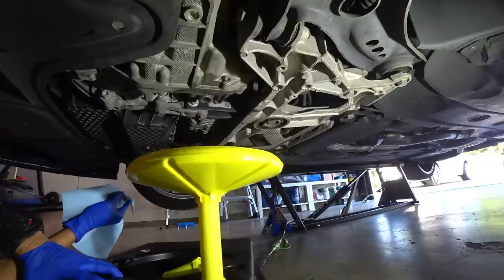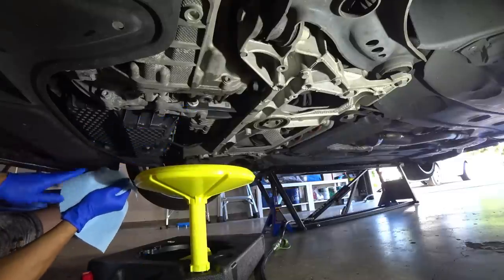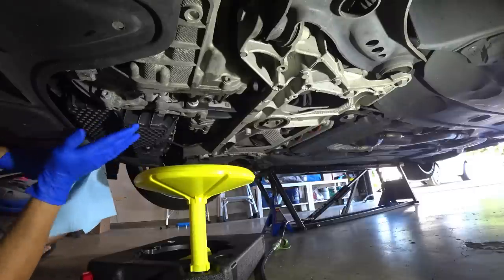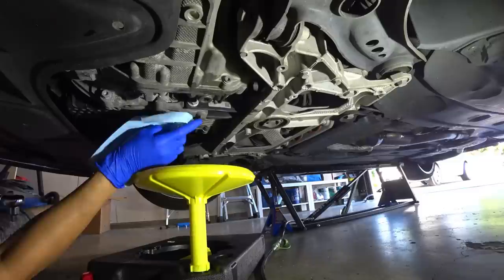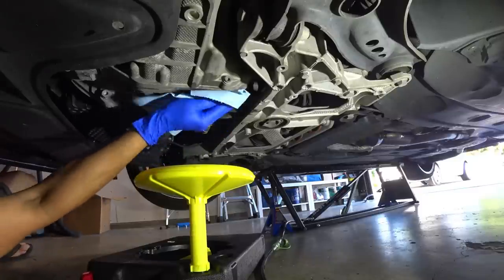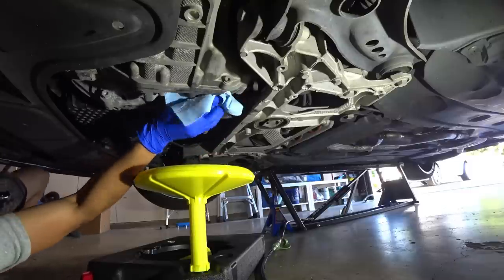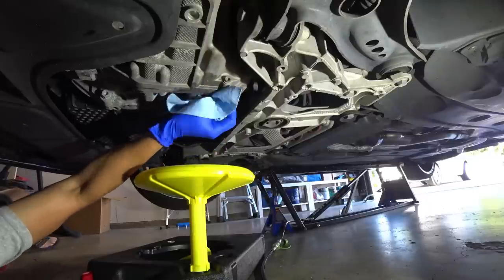And let's go ahead and pull this back here. At that point, the transmission should be completely leveled out in terms of how much it needs, and we open up the drain plug and let the excess DSG fluid out. We replace it once it stops dripping, and all I'm doing now is I'm going to go ahead and torque it down to 33 foot-pounds.